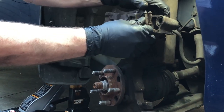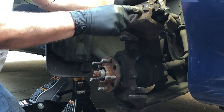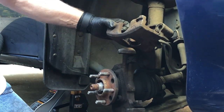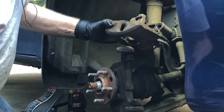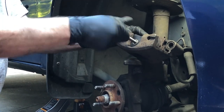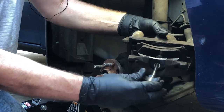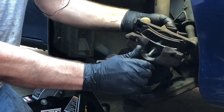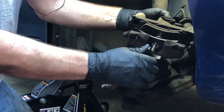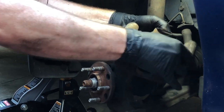While we're in here, since these pads are worn out, we're going to go ahead and replace those too. You've got to just give it a push and get the little notch out of the hole, pull that pad off, and pull this one off the main piston. When you get around to changing the pads, you need to be able to compress this piston with a tool like this, and you want to let that fluid go back through the hose into the master cylinder. We're going to close this gap so that when we're done, we'll have room for the new pads. A tool like this — I'll leave a link in the description — it's really handy. Once you get it to bottom out, we've closed that gap, so we have room for the new pads.